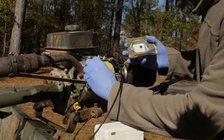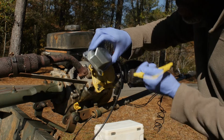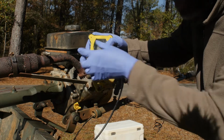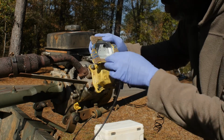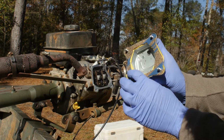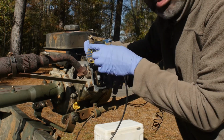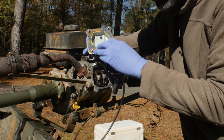All right, so what we did was we took this gasket, took some cardstock, made a template, traced it out on the outside, and punched holes here. So it fits in here snugly, like it has a little cup on it. Pierced some nails through here, and then we did the same with the rubber gasket. Because of the lack of precision with the cork, maybe the paper will make up for it. So you have to get the bolts through here, because I can never get the holes big enough, you know, so you put them through. It's not a perfect shape, so that's why we got the paper gasket backing and the cork, to try to make it work.